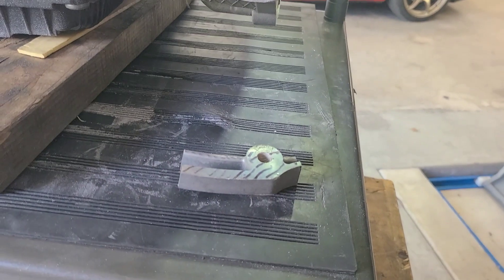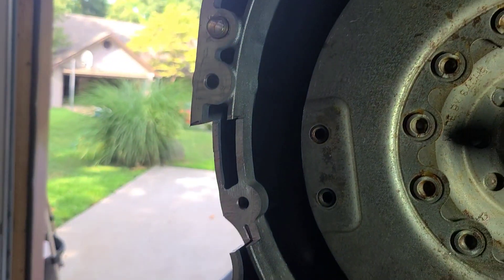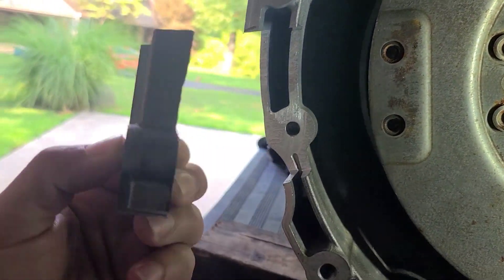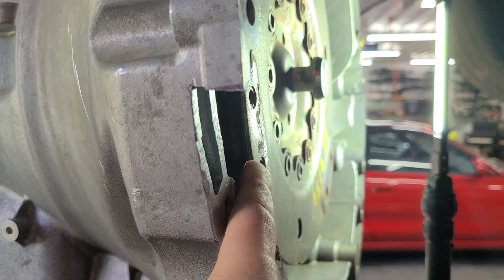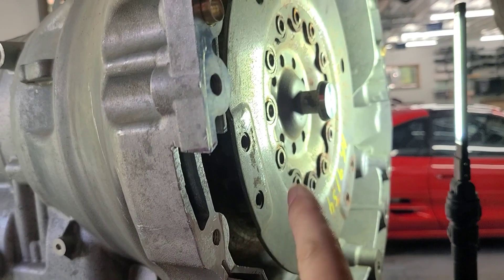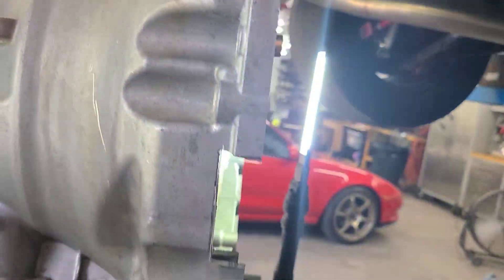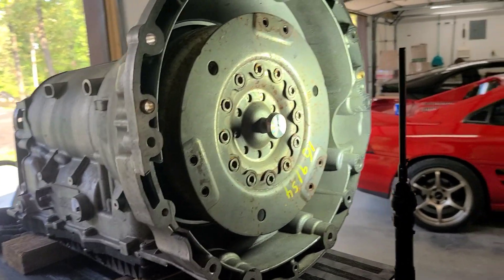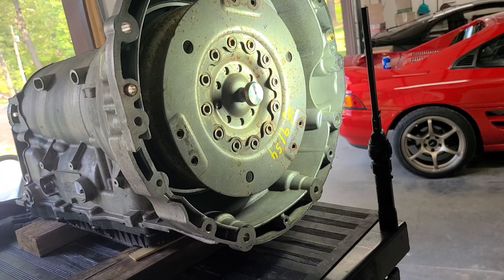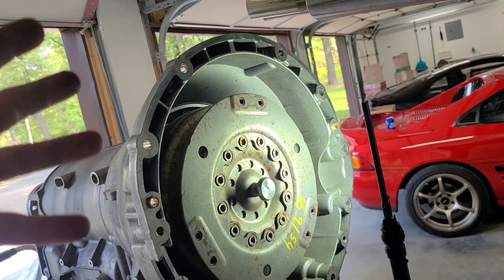The deed has been done — the piece has been cut out, it's right there. I don't exactly love cutting a chunk out of a nice transmission but sometimes this is just something you've got to do. That is the piece that came out right there, and I think that's going to give me the ability to reach in here and spin the converter. I should be able to get a thin pry bar or flat-head screwdriver in there and twist it just enough to align it to the holes in the flex plate so I can get a bolt started.